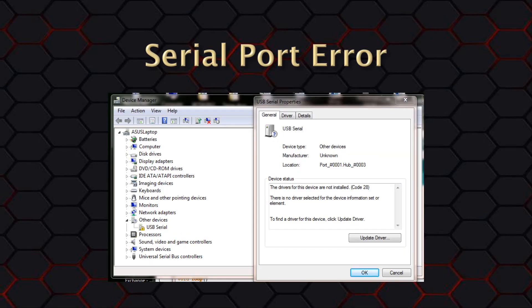For those that do not see any ports listed under the category Ports, Comm, and LPT, you may see an entry under Other Devices. It will have a yellow triangle and an exclamation point on the icon. Do a right mouse click over it and select Properties. You'll see the pop-up screen on the right. The error message in the device status box may indicate that the drivers are not installed. If you're not sure that is your USB to serial adapter or USB timer, you can unplug it from your computer. If that Other Devices entry disappears off the screen, then you have verified that it is your USB to serial adapter or USB timer that is having the problem.